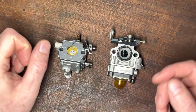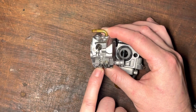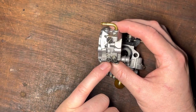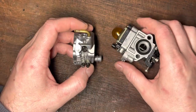However, if you pick it up and it wants to stall, or you turn it on its side and it wants to stall, that's saying you're giving it too much fuel on the low-speed screw. The fuel is pooling and not being combusted effectively. Lean out the low-speed screw slightly — that gives a little less fuel at idle, avoids that pooling, and you shouldn't have any issues.